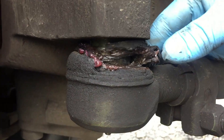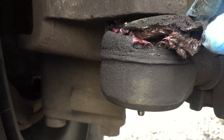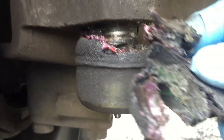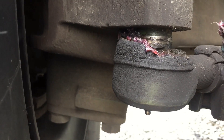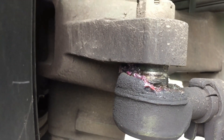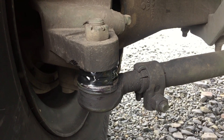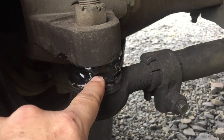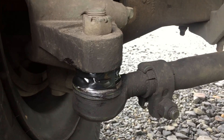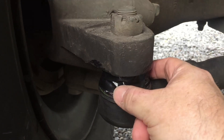Stabilizer. I've got a little bit of damage here. This thing is — yep, well, it's toast. It's completely gone. I'm going to still goop some grease up in there and I guess I'll just have to find a replacement for these. It's a good thing that you do these inspections every once in a while because this stuff can dry rot pretty easy, especially if it's been sitting for a long time. I know it's G-dirt and it's redneck, but just to keep the dirt out, I put a blue paper towel, folded it up, and then put some Gorilla Tape around it. Hopefully that will hold until I can get another one of these.